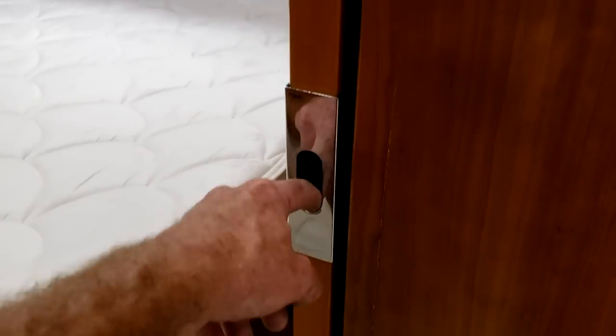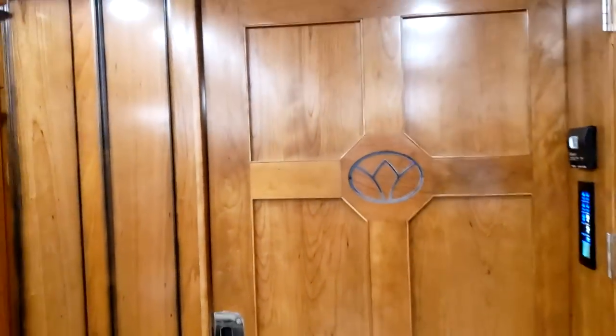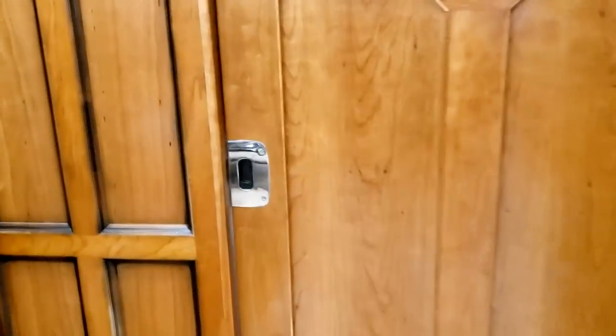Your pocket doors — just push down on that to unlock it and then you can slide the door. Before you drive down the road, it's absolutely vital that you make sure your pocket doors are latched in the locked stowed position. You will know immediately if you didn't do that when you turn a corner, because the pocket door will slam on you.